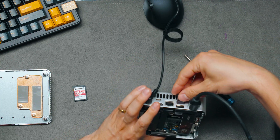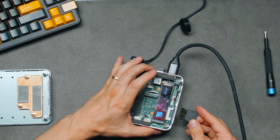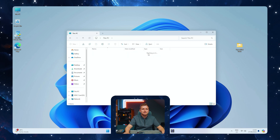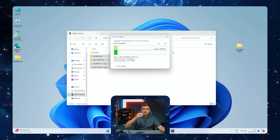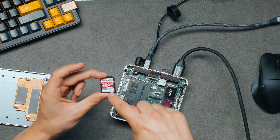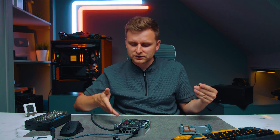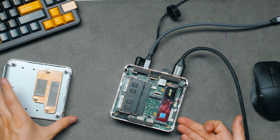Installing the SD card — it actually opens. This is a Kingston Canvas React Plus V90 card, UHS-II rated, which should read up to 300 MB/s. Taking files off the SD card to the desktop, we're getting about 180 MB/s. So it's faster than a typical UHS-I card (which tops out around 100 MB/s), but not reaching full UHS-II speeds. Geekom, why didn't you chisel a bit out from the chassis so we could actually use the SD card slot properly? It would be so useful.